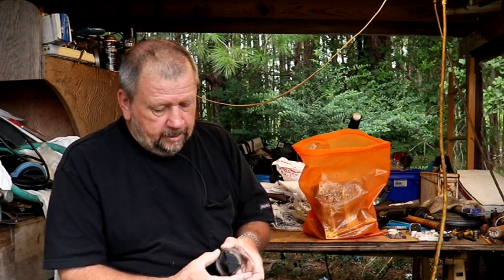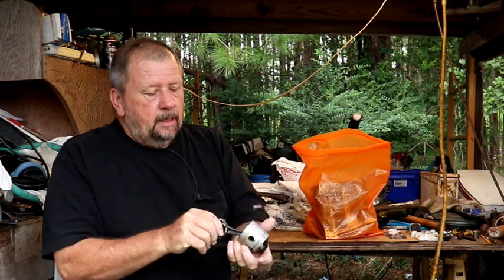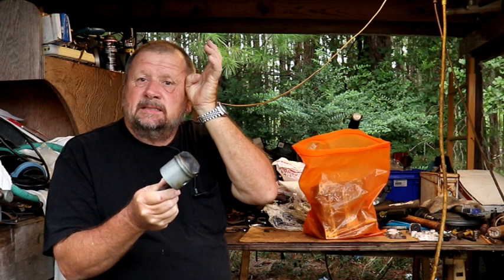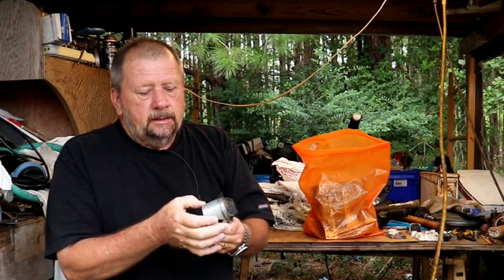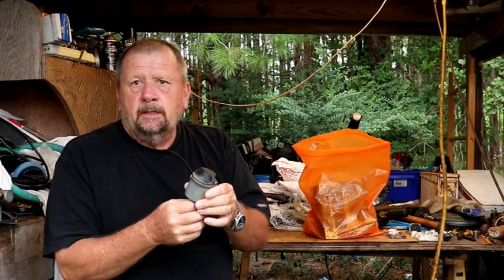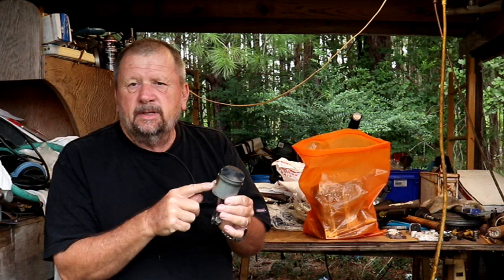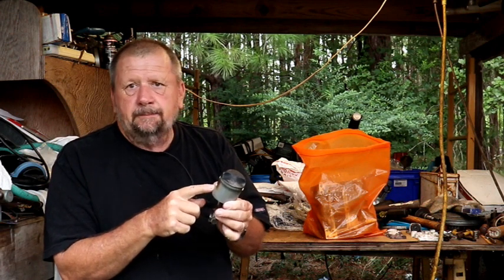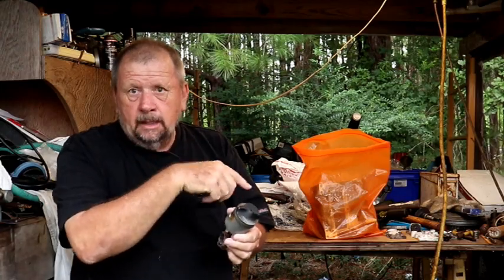You heard it. It's time to go to work. So anyhow, we'll get this cleaned up. Get a new set of rings on it. The reason I ordered the piston is Don, he had told us that with his years of experience that it is hard to get this wrist pin out of there without distorting the piston. And as you've seen, check the video.